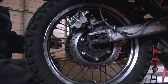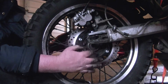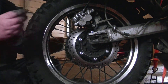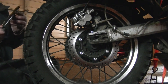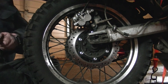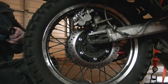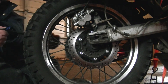Whenever you get to this position, you can still access where your axles and hubs go. That's when you start putting your cuffs back into place — the big one goes on the right, the small one goes on the left, just in case you got them mixed up. Your axle — you should lube it and inspect it for weird wear and tear, like galling or something like that. I like to use axle grease. My axle looks in really, really good shape — put a real thin coat on it.